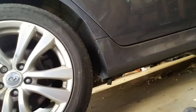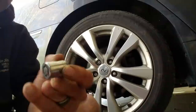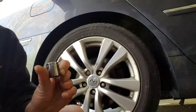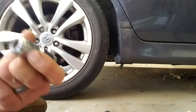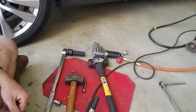I did figure out a way to get the front one off. That's my wheel lock nut — I am not putting that back on the vehicle. I'll stick a different lug on that stud. This method worked very easy. What you want to do is get yourself another socket. This particular one — three-quarter inch seems to fit fine. Nineteen millimeter would probably be about the same. It has a star head, so there are a lot of points to catch friction, and it's slightly smaller than the wheel lock. I'm going to force it on there with one of these tools.